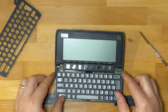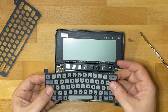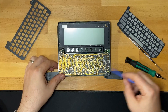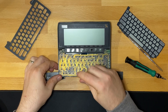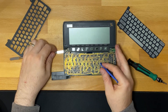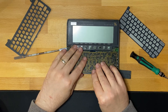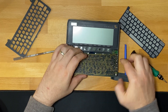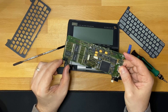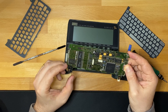This is the membrane keyboard — we're going to use this one in our Jaguar keyboard and give it a little bit of a clean. To get the motherboard out, I believe you have to push in the RS232 connector here. We've already taken out the batteries, so I'm hoping that this just slides out. That's fairly painless, although I have a feeling that's going to be really good fun to put back in.